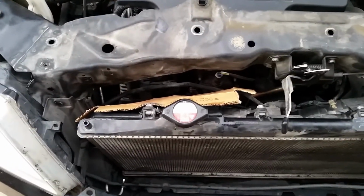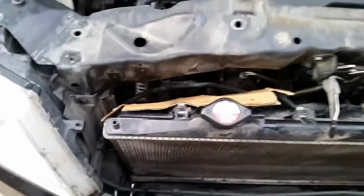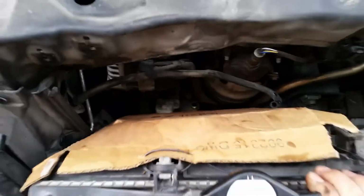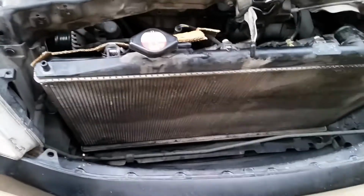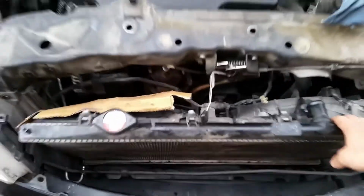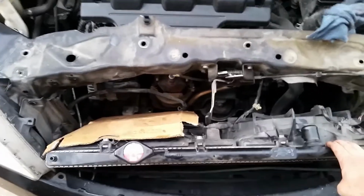this system. So this is actually a quick way to remove your AC compressor. I've seen a lot of people try and pull the alternator and fish it out from up here, but it's too tight to even slide through there. Some people can pull it out through the bottom, but the easiest way that I've found is just pull your condenser out. It's just two bolts, two lines, and then you can pop your radiator hose loose and just get it out of the way, and that'll allow you a lot of access here to slide your radiator back.